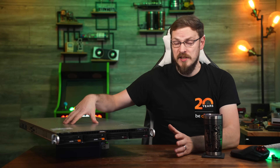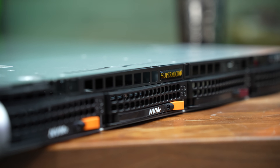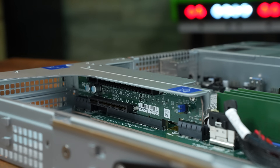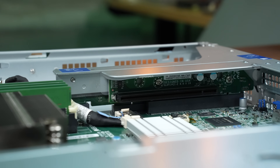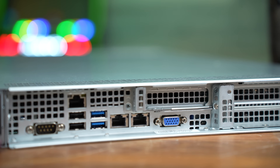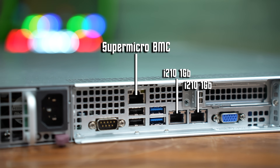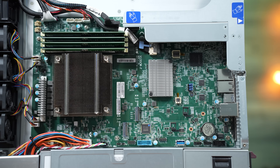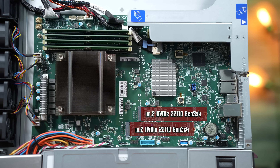The Supermicro 815 chassis, which this is built on, is a classic at this point — a 1U server chassis that's incredibly well built with an impressive amount of expandability. Up front, we've got four 3.5-inch drive trays connected to a multipurpose backplane supporting SATA, SAS, or NVMe disks. Inside the chassis there's room for three PCI expansion cards: an X16 and an X8 slot supporting full height and full length cards, plus an additional X4 slot limited to small form factor cards. The motherboard has an IPMI port, a pair of Intel i210 1-gigabit LAN ports, and a pair of M.2 slots supporting up to Gen 3x4 speeds.